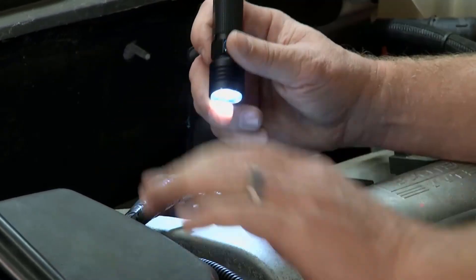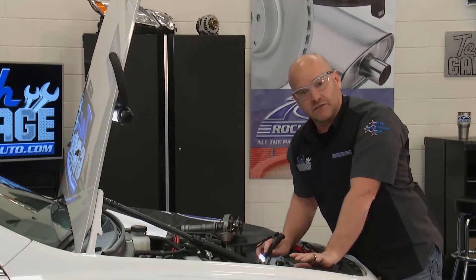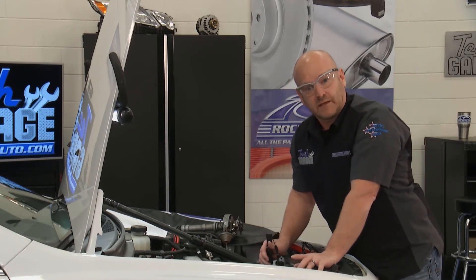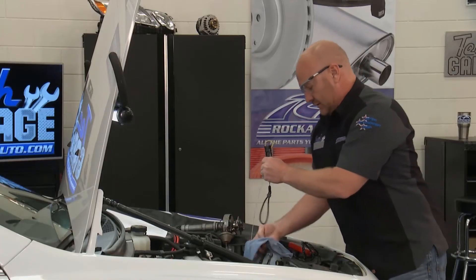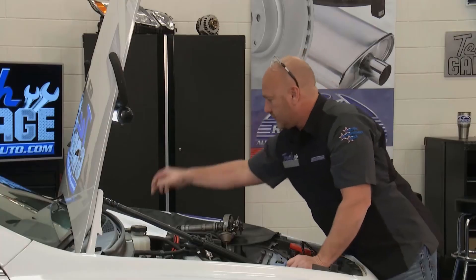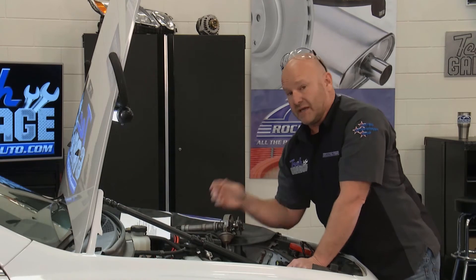Then you want to follow the wiring path and look again for any obvious damage. There's nothing that looks like a problem here, at least to the naked eye. Keep in mind — oil actuated — so the next step is to check the oil. We happen to know the history of this vehicle and the oil's been changed pretty regularly. No tarring, no sludge, no real issues. But you've got to have the right viscosity, the right flow, and the right oil pressure to make this variable valve solenoid work. Quick check of the oil — good clean oil, nothing obvious. For a lot of people, you might go to a service manual and follow the diagnostic procedure to a T, and you can do that, but it's complex and a little tedious. I'm going to show you how to do it in the driveway — you're going to be amazed how much easier this is.